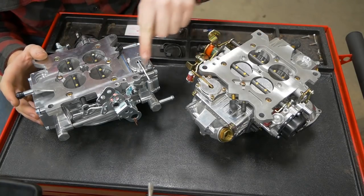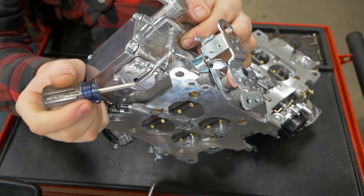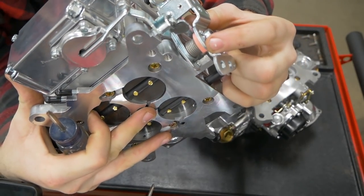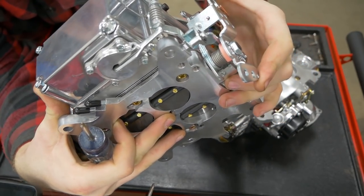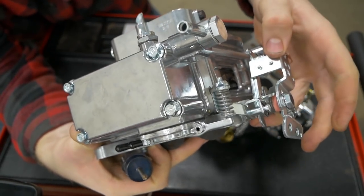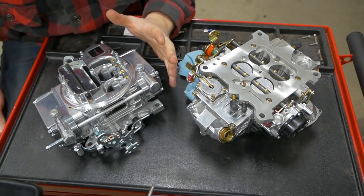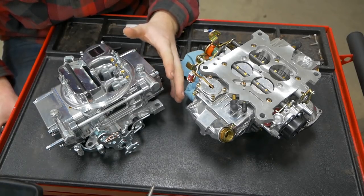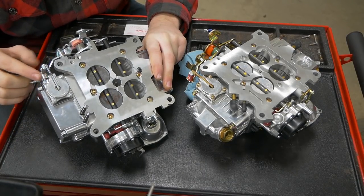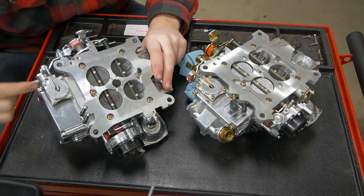That's what the accelerator pump is for. Both of these have an accelerator pump. Some mechanical secondary carburetors have two accelerator pumps. What these accelerator pumps do is compress a diaphragm with a rod and a spring. There's a pink cam right here and as I turn that you can see the accelerator pump is depressed as we stab the throttle open. You can change this cam depending on your engine for different durations, volumes, and timing of when you want that shot. On old carbs this is usually one of the first things to go — this diaphragm gets old and dry and cracks, and then when you stab the throttle nothing happens because the diaphragm is bad.